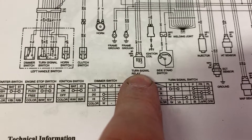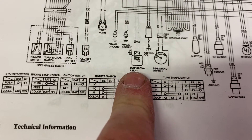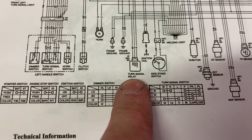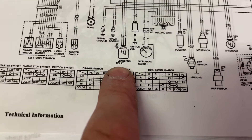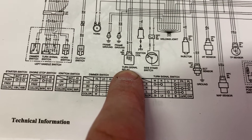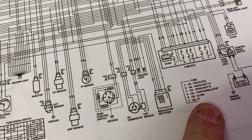We don't need anywhere near that much — we're 3.6 amps, that's 3.6 amps for both grips on high. The turn signals draw at most maybe an amp, amp and a half — let's call it two amps to be safe. So that's five and a half amps. GPS draws an amp, so we're maybe six and a half amps on a 10 amp circuit. We should be totally fine.